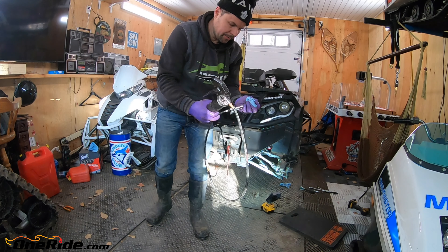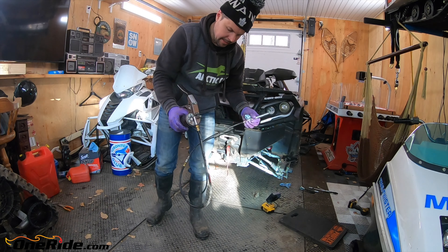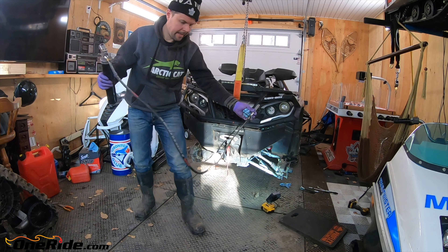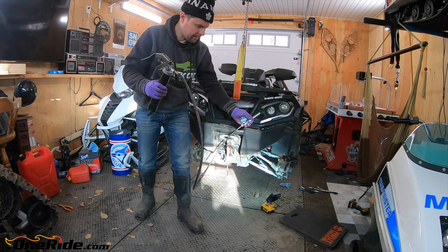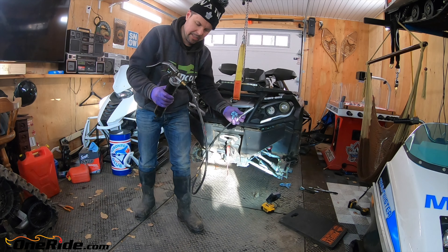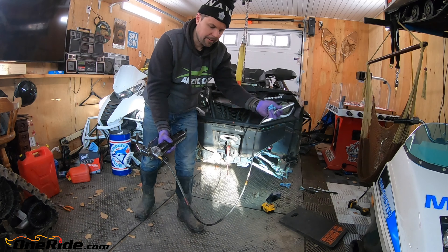The greasing's done. I had a little issue with the grease gun - the tip was worn so I had to replace the tip. To help with greasing, I actually added an extension on the hose because some of the areas you have to reach are tight, so you can just leave the grease gun on the floor and get the hose wherever you need to go.